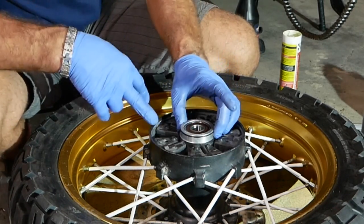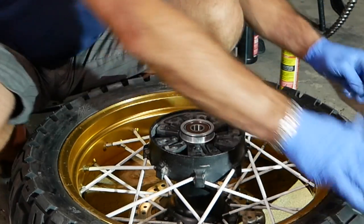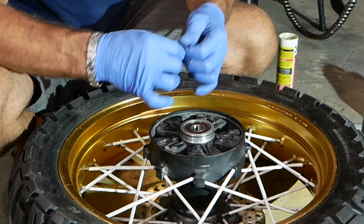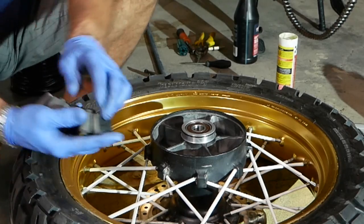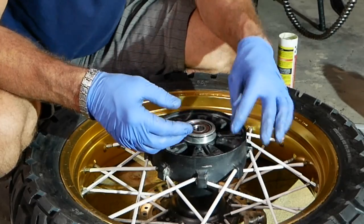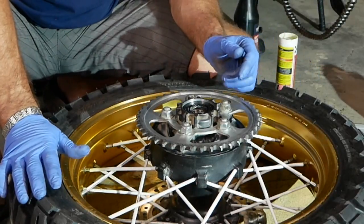One of the last things — there's an O-ring here. I don't think it's necessary to change it because this one is totally okay, but since I bought the whole kit I might as well install the new one. The O-ring part number is right here if you need it. Apply just a little bit of grease on it. Now you want to install your damper rubbers and then your whole sprocket assembly. That's pretty much it — it's pretty simple, as you can see. Nothing really to it, takes just a few minutes.